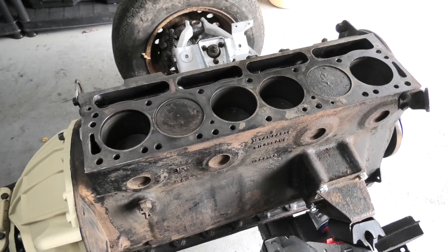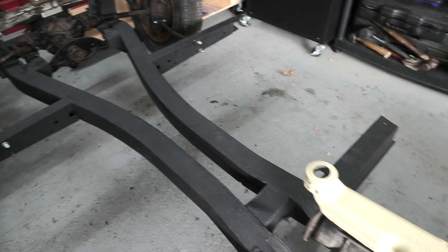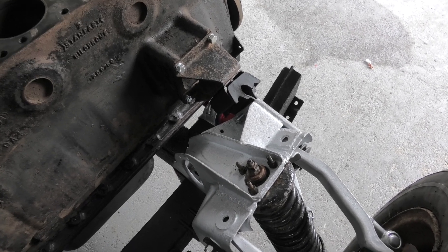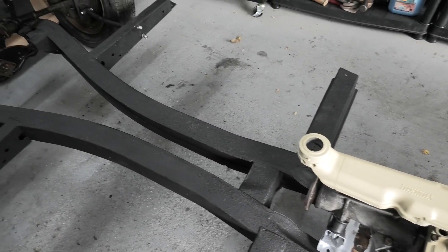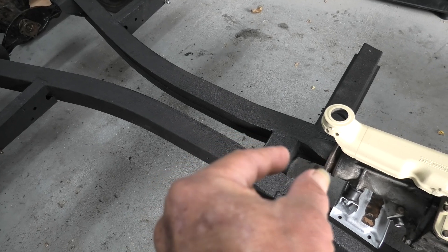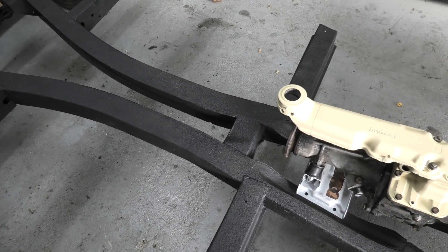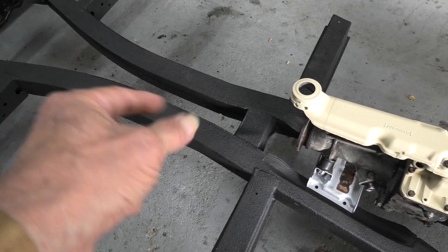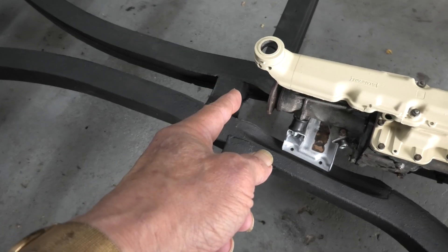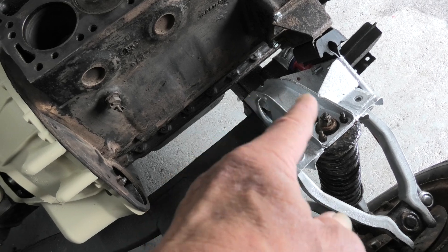So just a very short video of what I'm up to at the moment. There won't be anything happening for a couple of days until I get the prop shaft, and these cut out and welded on. I can't really do that until I get the prop shaft, because the prop shaft is the defining factor. It is a fixed length, bar a little bit of difference where I've got the splines on the prop shaft — it allows for a bit of movement, not a huge amount, but there is some. So if I can get the prop shaft in, that will give me the exact dimension between the prop shaft flange and the gearbox flange to go back three and a half inches.